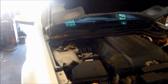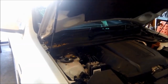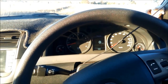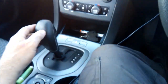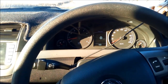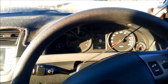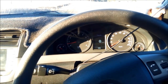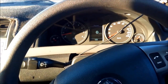There's a bit of slipping, so we're going to quickly put the scanner on it and see if we can get any codes out of it. What it's actually doing is when you floor it there's no power, so I'd be assuming it's an engine problem. If you select manual first and take off or reverse it should take off fairly hard, but it's like there's not enough fuel or the exhaust is blocked — so it looks like it's probably got other problems, not the transmission.